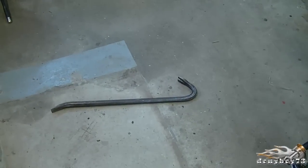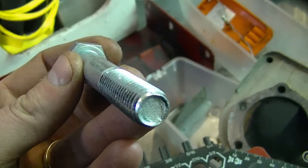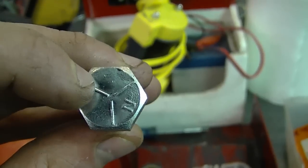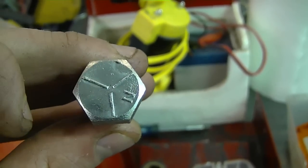Now you're not going to need a crowbar to remove the fan, but what you're going to need is a half inch in diameter bolt. And by the way, this is a standard bolt, it's not a metric bolt. The way you can tell if it's standard is the three notches over here to indicate it's grade five — the metric ones have numbers and not the lines.